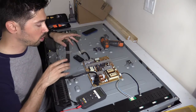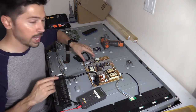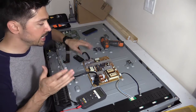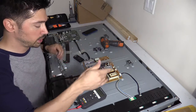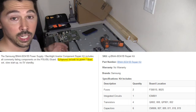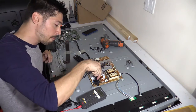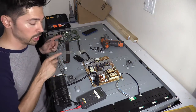Because I fixed a TV before with the same symptoms - 5 volts standby voltage dropping down to 0 - that one was actually bad capacitors on the power board causing the 5 volts to drop. So when I looked at the repair kit on the ShopJimmy website, it just made sense to order it because it had capacitors, the IC, the voltage regulator - parts that made sense and would cause the 5 volts to drop. And the description of the repair kit said no power, so I jumped on that. To recap: unplug the power, unplug the cable going to the main logic board, plug the power back in, and see if the backlight turns on. If the backlight turns on, then the power board is good and the main logic board is most likely bad.